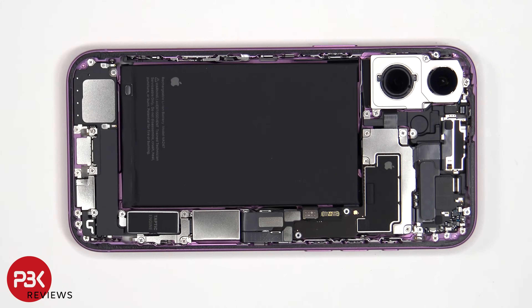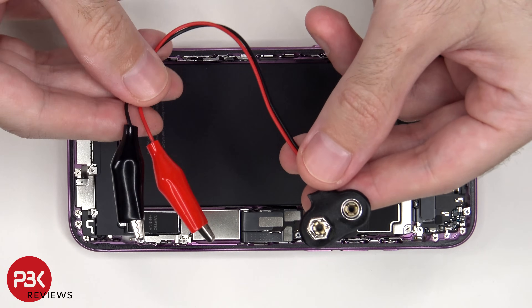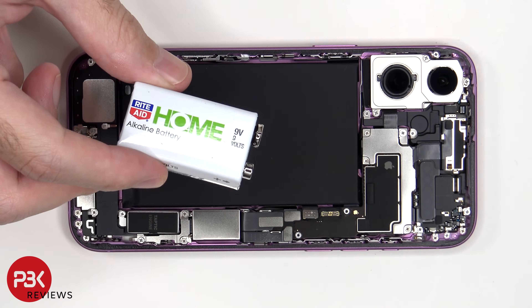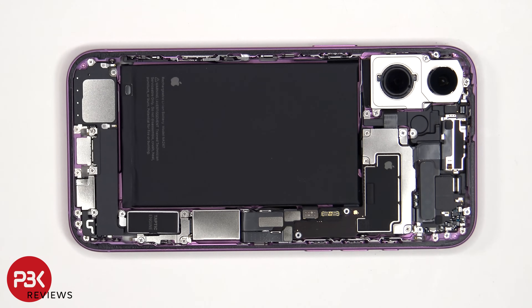When it comes to removing the battery on the iPhone 16 and 16 Plus, it's not a regular adhesive like it was before. There's a new electrically conductive adhesive which needs to be debonded for the battery to be removed. In order to do that, you're going to need some alligator clips as well as a 9V battery. You can safely go up to 30V to shorten the debonding process and remove the battery quicker. With a 9V battery, it should take about a minute and a half.